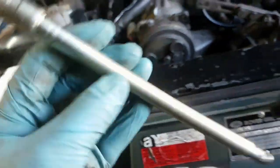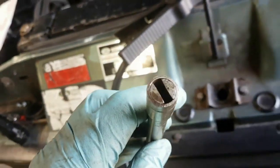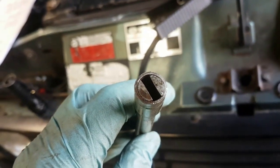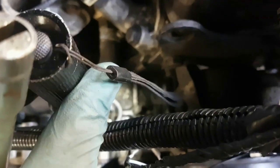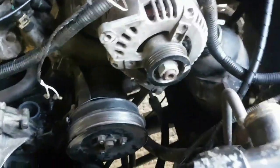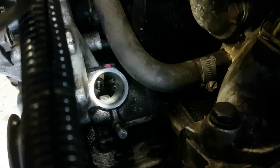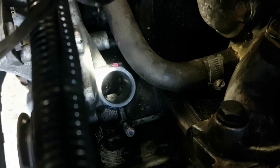This is where I use my trusty little oil pump prime tool — very useful for this. You can also use something like a 12mm socket on an extension bar; ideally a six-sided one, as I think that goes over it and allows you to rotate it. So don't panic about getting an oil pump drive tool if you need to reset the oil pump position. The engine does look quite clean inside — you can see the drive there, the skew gear off the front of the camshaft.